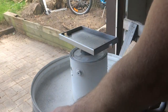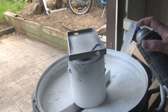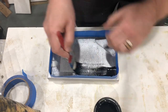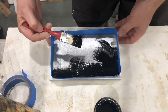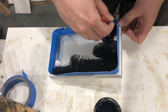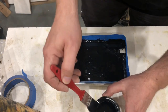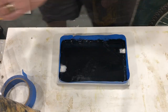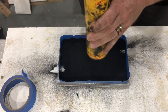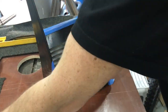The insert is the only part of this project that I'm not spraying black. I did that because the factory trim is sort of a silver color — this is actually the same silver I used for my wheels. And the inside of that silver insert is actually going to be covered in flocking. Flocking is like a suede when it's finished. What I should have done is sprayed the bottom black first, but I goofed on that. You apply this glue — it's a fairly thick glue — and then you squirt on the flocking. You get a little flocking cannon when you buy it, and it just squirts out. It ends up looking like a suede when you're finished. You remove the excess and it needs about 24 hours to dry.